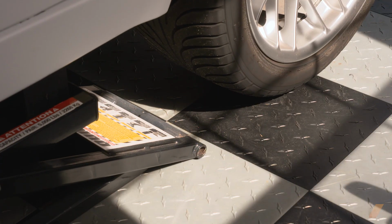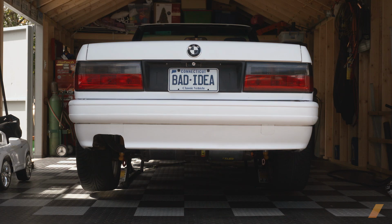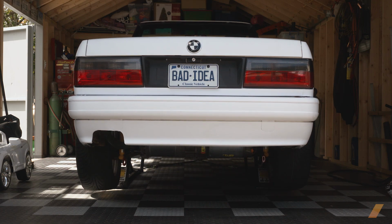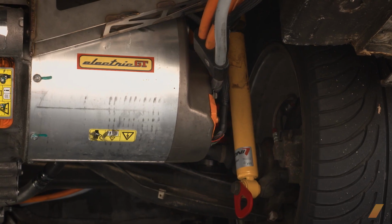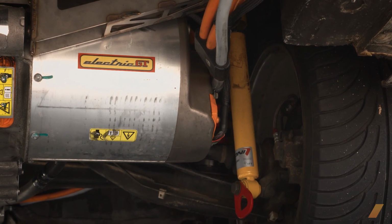The motor is what they call a large drive unit out of a Tesla Model S. It's basically a completely self-contained unit, and the entire thing's held in the car by only 3 mounts. So there's no transmission per se, there's no gears, it's just a single direct drive.